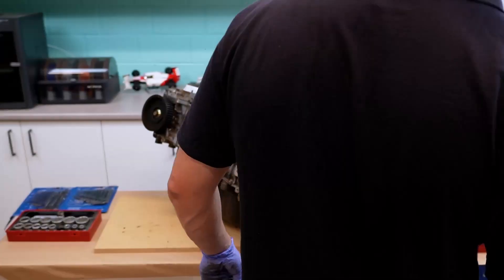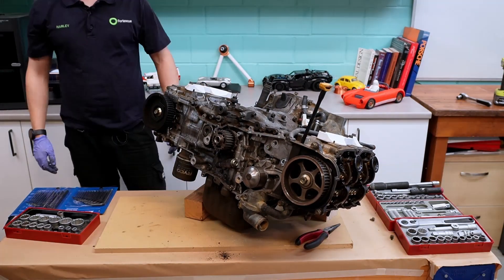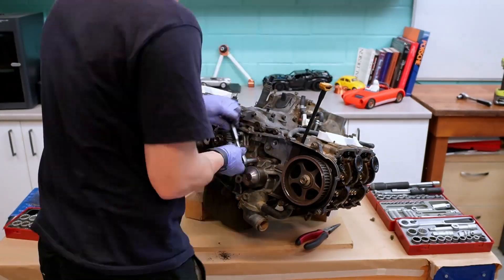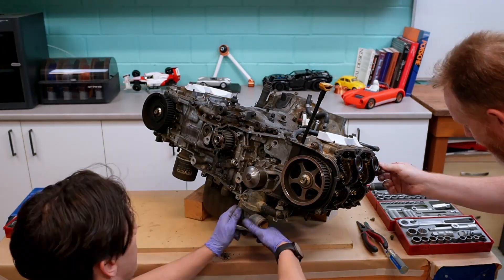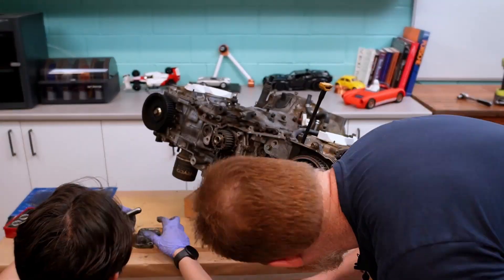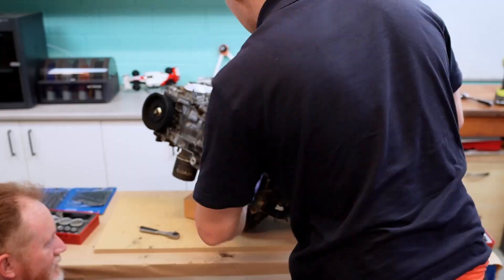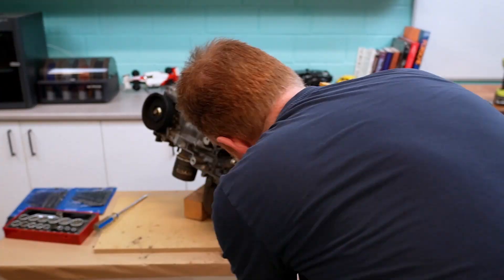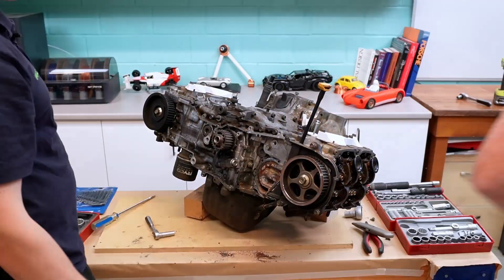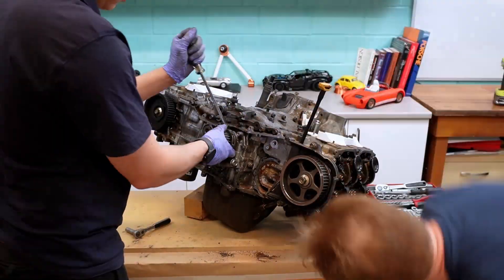But I didn't want to buy it to rebuild it. This engine was always intended to be stripped as a mock-up engine. So the goal for this engine was to build a lightweight, dimensionally accurate mock-up of an EJ20. We'd be using this mock-up for helping with the chassis design, making sure we've got a really good engine bay layout. The best mock-up is an actual engine, but engines like this are heavy, messy and difficult to move around during prototyping. So what I want to do is tear this down and only use the external components to make a much more cleaned up and neat and tidy looking mock-up. As we're doing this stripping of the motor, we can weigh all of the components — this helps us get dimensions and weights of all the individual components, which can help us with future modelling.